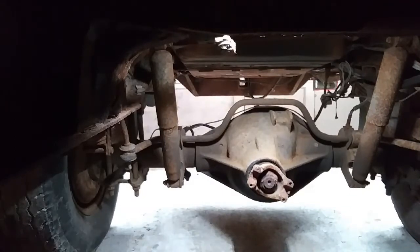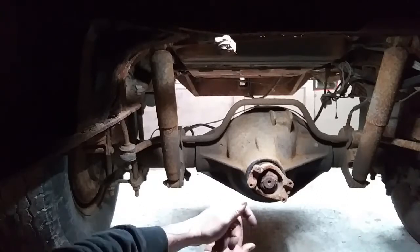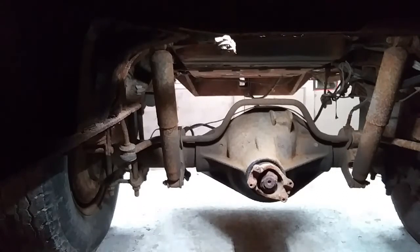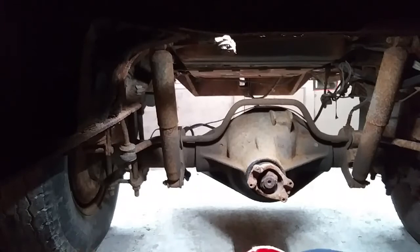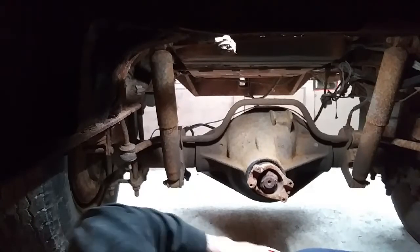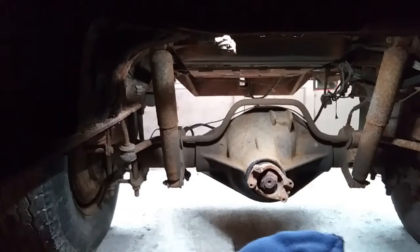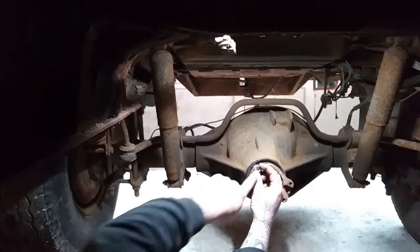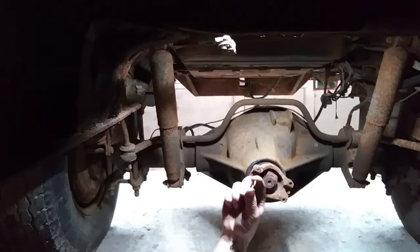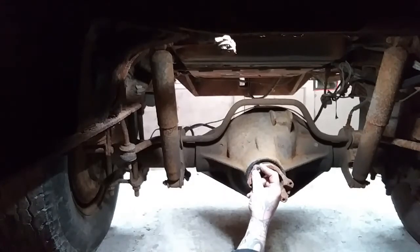Alright, so typically on a broken bolt, if there's enough hanging out that you can get a nut started onto, where it's come through the nut enough to weld it, I just say go ahead and weld the nut on it. What I like to do, if it's pretty much flush, I'll take a washer. I'll dig through my pile of washers and find one that's pretty much the same size inside diameter. Okay, the washer's thinner, obviously, so it's easier to weld the washer to that bolt.